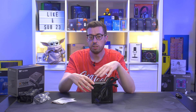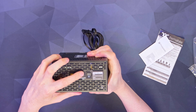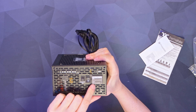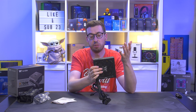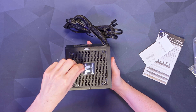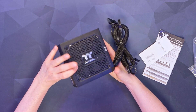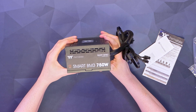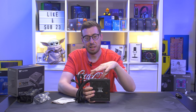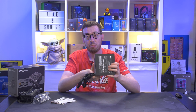Personally, I would use the higher end of the three wattages if you're going to do that. Going to the other end of the power supply, we've got the zero RPM fan mode - like I said, if it's less than 20% load, the fan won't spin. There's also a little sticker there to tell you before you plug it in that the fan won't operate at lower loads, so don't freak out if you don't see it spinning. There's a 120mm fluid dynamic bearing fan underneath there. Each side we've got just some branding - SmartBM3 750. It's also going to be the right way up if you put it fan-side up, so whatever side you've got in your case, you will see the logo the right way. Good job Thermaltake for making sure it's going to be the right way up no matter which way you put it in.